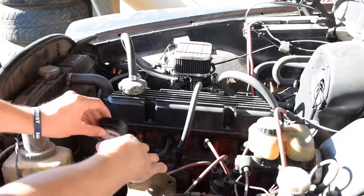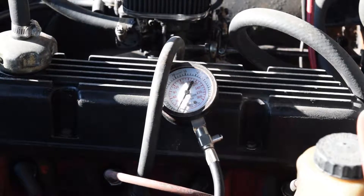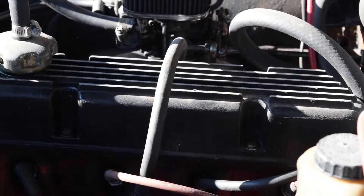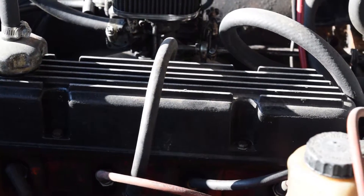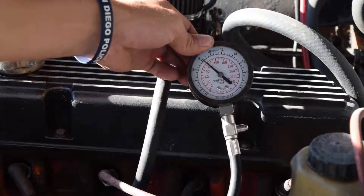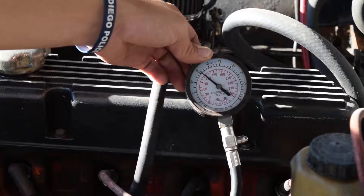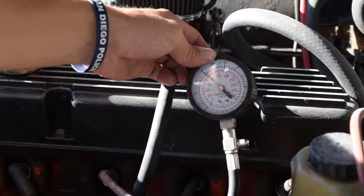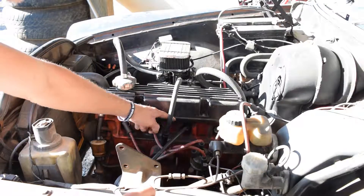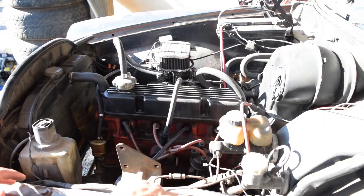Also, you want only about 5 to 10 psi difference between the cylinders, and this is almost 30, so not looking so good. We'll test the other two cylinders, and that could give us some insight on what's wrong with it. Here is cylinder three pressure, and this one is looking like it's just under 120, probably like 118 or so. That's actually very close to cylinder number two, which is good, but bad because it's only 120 psi. Right now I'm suspecting head gasket, or maybe the head is warped, because cylinder one was 150 and we got 120 and 120 again — I'm thinking maybe the head's warped, or there's a break in the head gasket right around there.